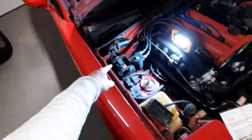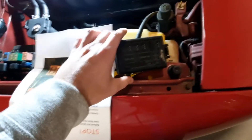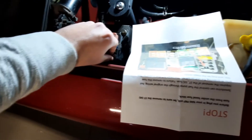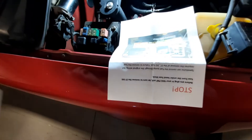This is where the fuse box is, right beside your wiper motor. The picture is kind of weird because you look at it this way, but it actually goes this way. You're just removing this 10-amp fuse in the corner. In the box, you can see right here that 10-amp ST sign — that's the one you're removing. Just go to pull this out and there you go. There's your little 10-amp fuse removed. That's step one, easy.